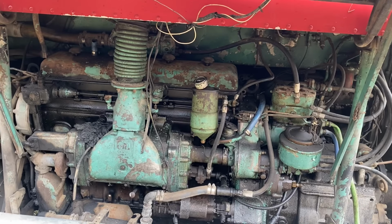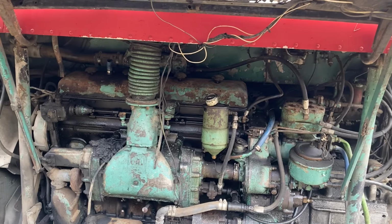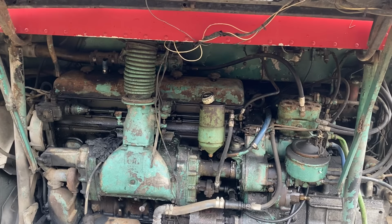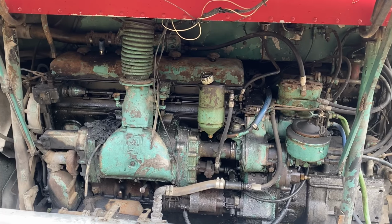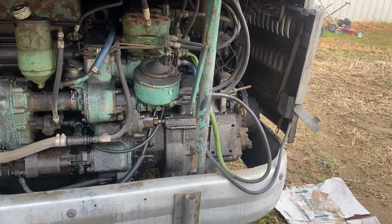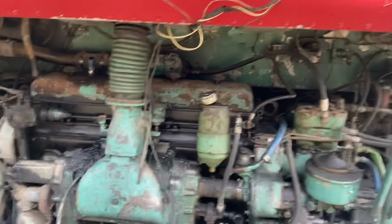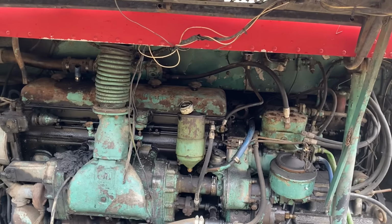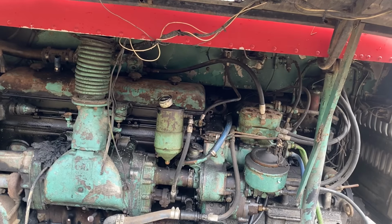But yeah, so hopefully here in just a few minutes after we get back from Rural King, get some coolant in it. It looks like it's going to take about 18 gallons. I don't know if the heating loop is opened or not. I'm going to close the valves to it. We're going to go get some fresh diesel, and we've already got these lines here, so we don't have to run it off the tank. We can run it off of fresh diesel right through those hoses that they've got there. I've checked the oil bath air filters are good. They're filled with oil. There's no rodent nests in them, and they're not filled with water. And everything is progressing along nicely here.